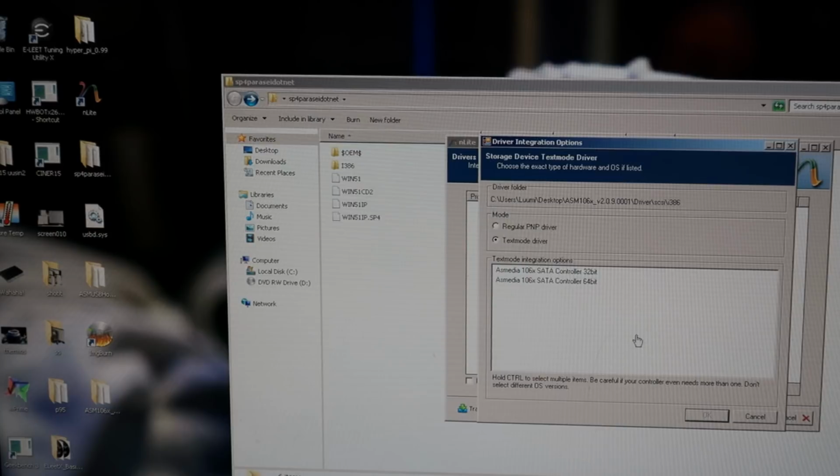Back then, the 32-bit version of Windows XP was much more common than the 64-bit version. The 64-bit version was kind of buggy, it wasn't so popular, although it could be more compatible nowadays with newer hardware, as the 64-bit version can run much higher memory capacities and so on. For overclocking purposes, the only real benchmark that really can run faster in 64-bit version is pretty much 3D Mark 2001 from the old tests. All the other old 2D tests, as well as some of the 3D tests, run better in the 32-bit version, like SuperPi 1M and 32M, PiFast, W Prime, and 3D Mark 03, 05, 06, and AquaMark with some old graphics cards, like for example GTX 285 or older.